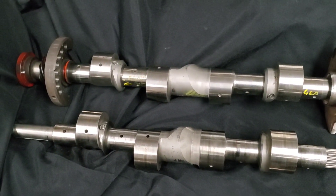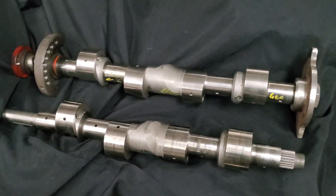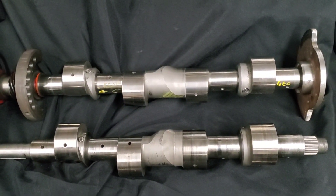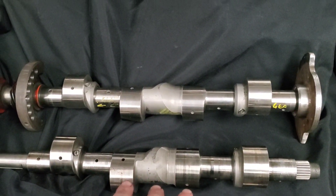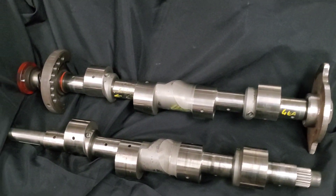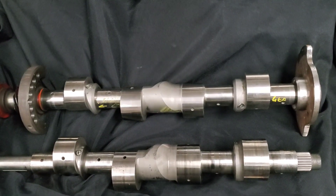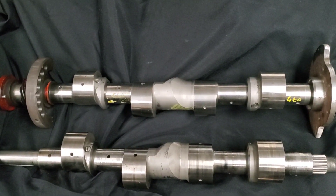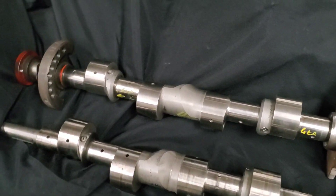As we moved into more recent times, 12A components became a lot harder to acquire. They're actually rare parts, and Mazda as a manufacturer has stopped manufacturing some of those 12A components. So nowadays you really don't see very many 12A based four rotors, and the majority of 26B blocks being built are using 13B components from Mazda, because a lot of those components are still available — your side plates, your rotor housing, your rotors, gears, bearings.